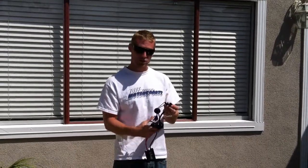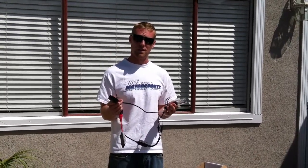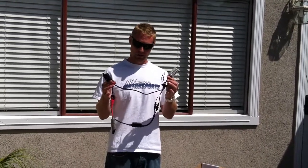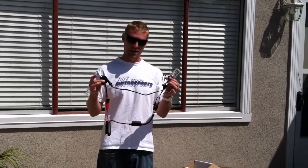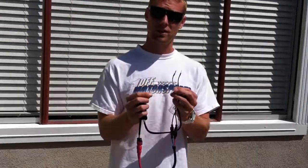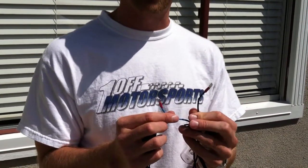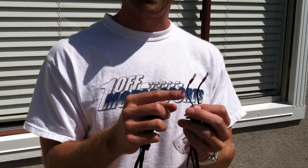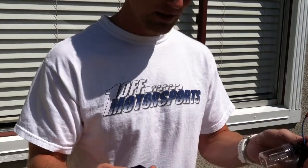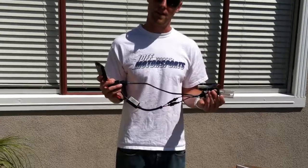You now have a complete circuit of what you're going to install on your BMW motorcycle. It's going to be a little bit different getting to the back of your bulb depending on your make or model, but all of this is the same theory. You now have a new HID completed circuit with a CAN bus module. Everything's connected, except for two pins. These two pins are what you're going to plug into the stock factory housing in your BMW motorcycle. The black is going to be the ground and the blue or red wire is going to be the power. You're going to plug this into your stock factory housing where your halogen bulb once went in and just find some place to mount the rest of this circuit anywhere within a foot and a half of the motorcycle.